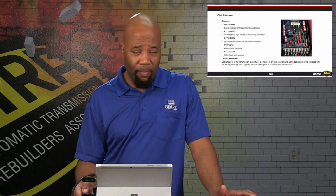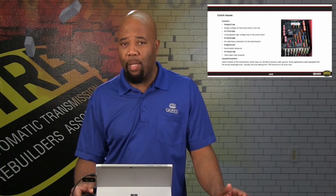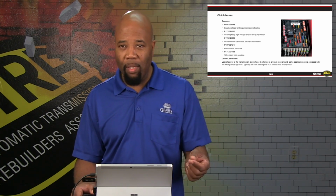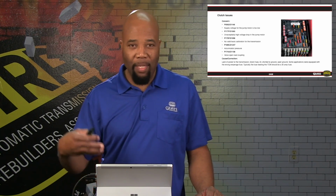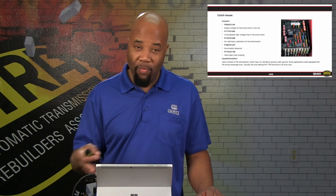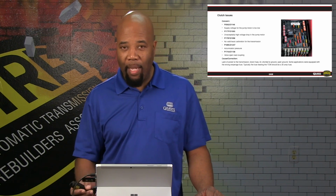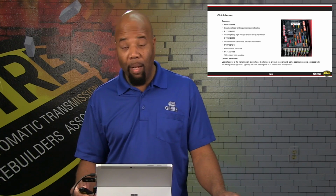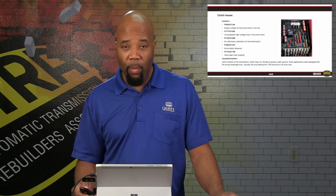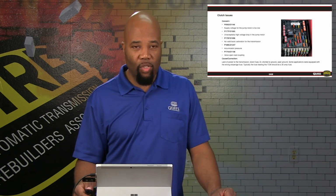So again, if this fuse blows frequently, it might be relative to the pressure, the pump motor cycling on and off. If that happens to be a simultaneous situation, you do want to verify your current draw by using a breaker and an amp clamp in that application, because that could indicate a failing pump motor, or we could have a fuse of the wrong rating in that location.